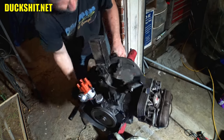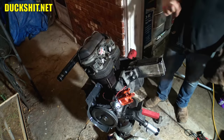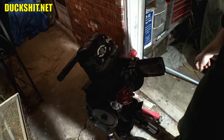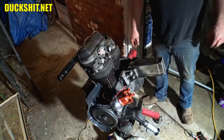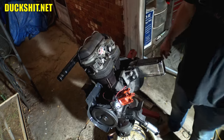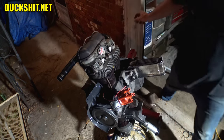Once I've got the valves set, I can smack the rocker cover back on, then tip the engine up the other way and see if she leaks. We've got our valves adjusted, the cover's back on. Standing the engine up now — we'll let it sit with oil on that side and see if we get any leaking out of our push rod tubes. I'm pretty confident things are good, but that's usually not a good sign because usually that means I'm going to find something wrong — just like my brake line when I said I'd never had one leak before.